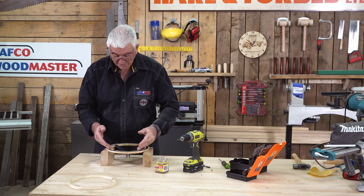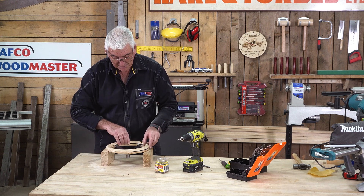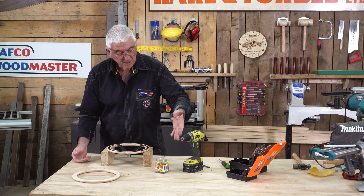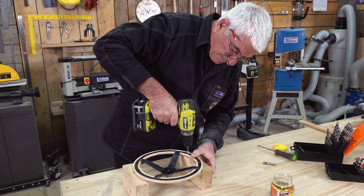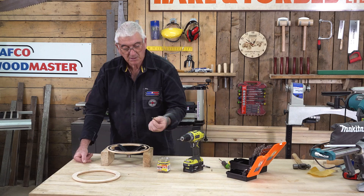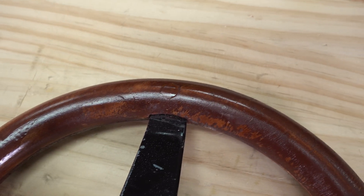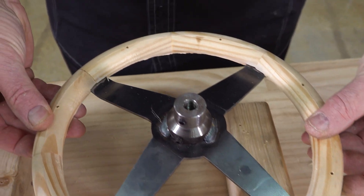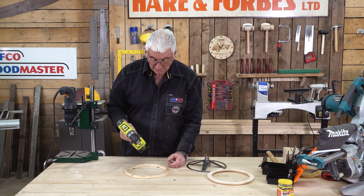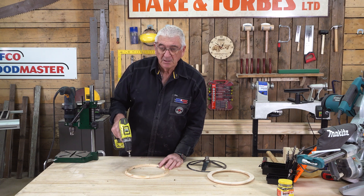The next step, once I've got my metal ring in place, is to drill out the appropriate holes. I'm going to be fitting screws through the back piece to hold it all together. I've chosen a 2.5 millimeter drill bit for my pilot holes and I'm going to use a pan head type screw. You can use a countersunk type screw, which means later on you'll need to fill and hide the holes. I've separated the metal centre from my timber steering wheel and I'm now countersinking the screw holes.